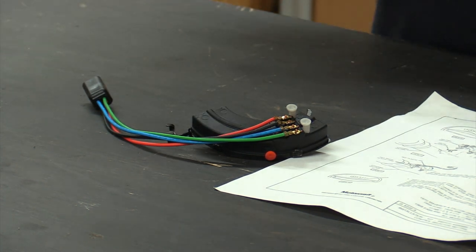These things can be problematic. If you're having a starting problem, sometimes it's the neutral safety switch causing the issue — they can get gummed up or fall apart inside. Some people just take them out because they don't understand the function. This literally keeps you from running over your friends. Cam and I were working on the 69 Fairlane wagon, which has a malfunctioning neutral safety switch — mostly because it's unplugged. I got in the car, knocked it from neutral into drive, and when I went to start it, the car lurched forward with Cam in front of it. You really don't want that to happen.